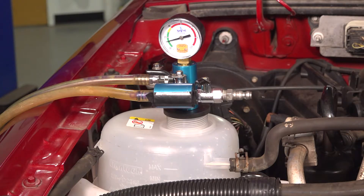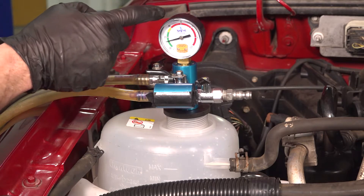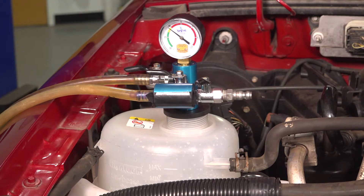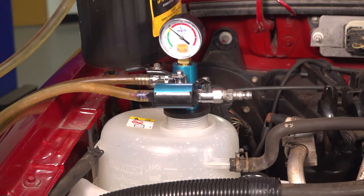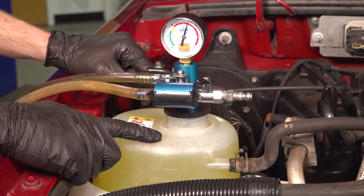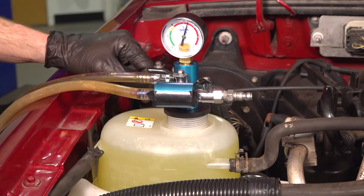If you're using a vacuum system, it's important to make sure that the system does hold vacuum. Watch this gauge here and make sure it doesn't drop down into the yellow or worse, into the red. Assuming it hasn't moved into the yellow or red, we'll continue on adding coolant. The coolant is making its way above the maximum line but it's also drawing the coolant down at the same time. At this point, we're going to release pressure here, allow this to make its way down, and then top it off as necessary.